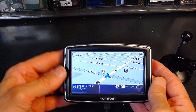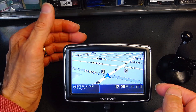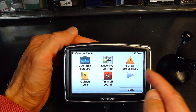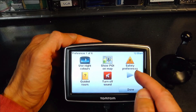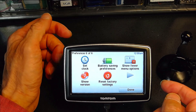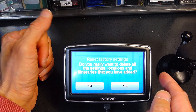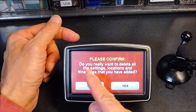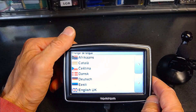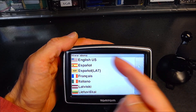When you first get this GPS, it's good to do a factory reset and customize it the way you want. To do a factory reset: click here, go to Change Preferences, hit the right arrow button several times to find Factory Reset, press it, and it will ask if you really want to delete all settings and locations — yes. It will ask again to confirm — yes.